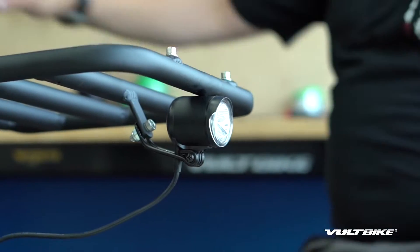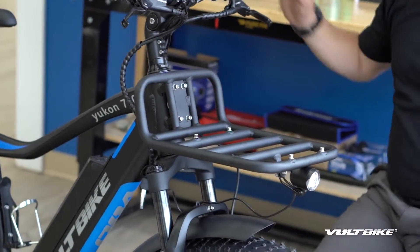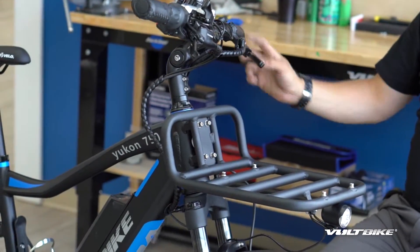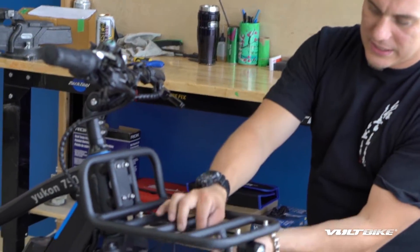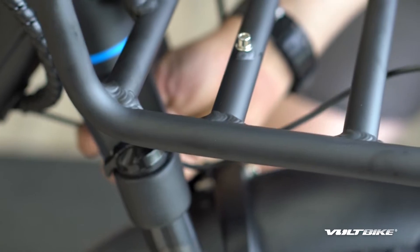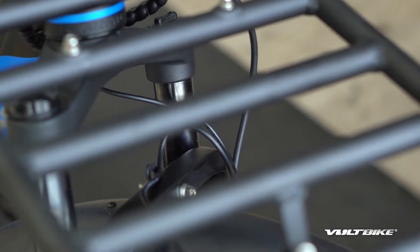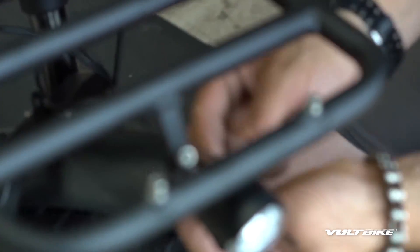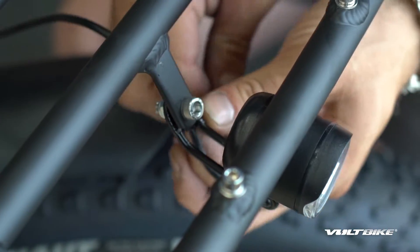Now probably the most important part of this install is cable management. We've got a cable here and the wiring harness in the front — we want to arrange this so there's no catching in the steering motion and so that if something on the rack gets used, it's not going to take out the light cable. My preferred method is coming up to this secondary bar, running it along the bottom and then right to the front. I may need more cable, so again I'll gently but firmly tug from the frame. Then I'll use small zip ties to strap it up and out of the way — the first one I like to do is to the actual light bracket itself, which will keep it from catching on things.